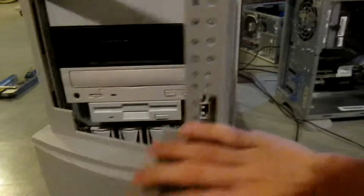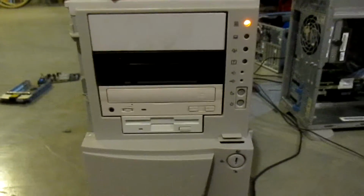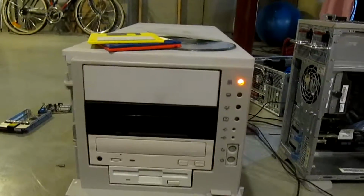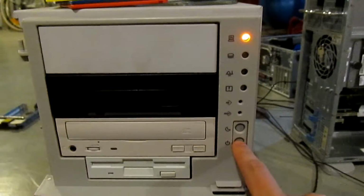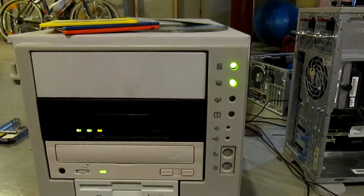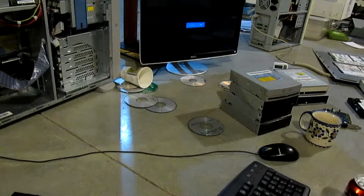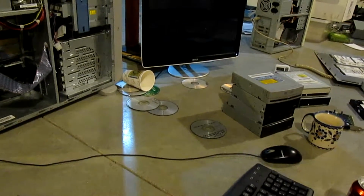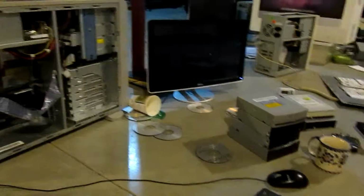And if it does what it usually does upon first boot, it will not power up because the one's processor is not seated correctly or something, or the connection's dirty or whatever, so it will do nothing. So here we go. It'll be a slight delay before it powers on. Told ya. Now let's see. The screen will turn on, but these little LEDs on the keyboard will not do a thing. And it has. So now you get to see the process in which I reseat, quote unquote, the CPU. So let's just turn this off. Okay, I guess we're not going to play ball.